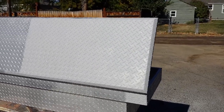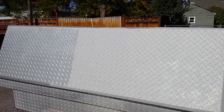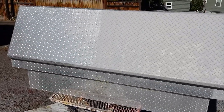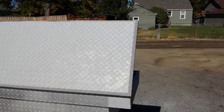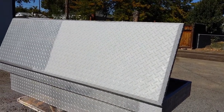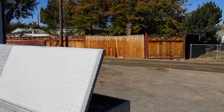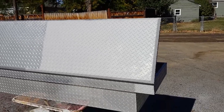As we found out, it takes a lot of sand to do this. You can see how far we got — that was with one bag of sand. We're catching the sand now and going to try to reuse it; it ain't going to hurt nothing. Another bag and we'll have the top done and part of the side. We're not going to sandblast the bottom part since it'll be behind the truck and nobody will see it. The point is to give the paint a good grip so if you bump it, it won't chip off.